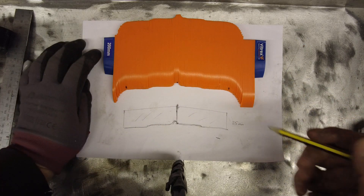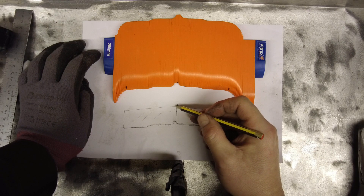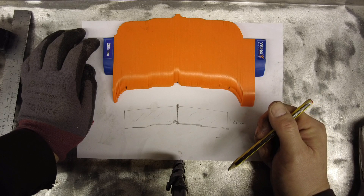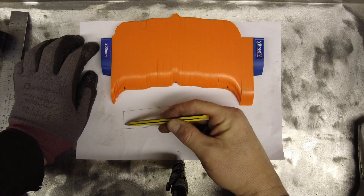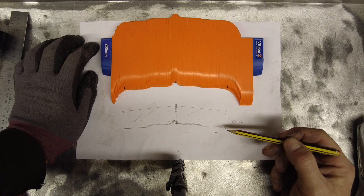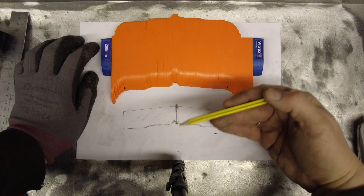I've done this a couple of times and double-checked it. The center of the gearbox ridge there is actually slightly off-center from the center of my strap, so I'm assuming the strap is slightly out of center. I don't think that's a major issue - I'm going to mold it as it is, and if the strap is out of center it just means the bush should be slightly off to one side. There's so much bush at both sides of the gearbox I don't think it'll be an issue. I've decided to make the bush 25mm deep. The ridge in the center goes front to back on the gearbox, however there's a ridge that goes side to side as well. Because of the placement of the strap it's going to be a problem, so I'm going to create the mold as it is and then try and cut out a channel side to side so the bush sits neatly over it.